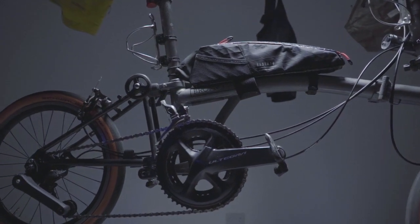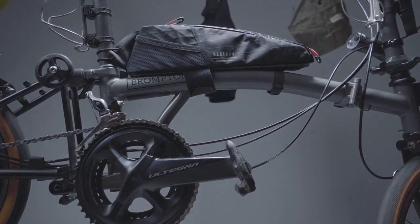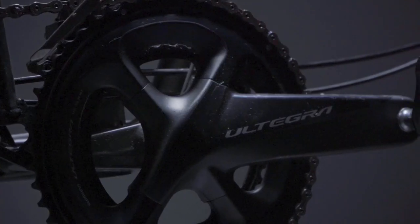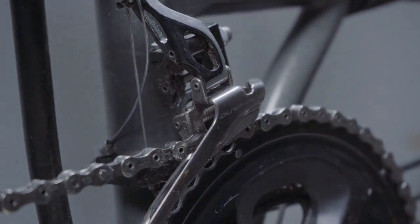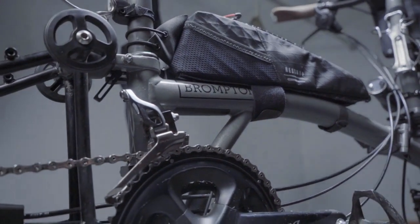There were a few tweaks I made to the bike to make it as suitable as possible for the big distance. I had the standard four-speed Brompton derailleur on the back but added a Shimano Ultegra crankset with a double — a 52 and a 36 chainring on the front — with a Dura-Ace road front derailleur, changing it from a four-speed to an eight-speed, using a Sunrace friction shifter for the front derailleur. Just a bit more versatility, mainly for the hills around Kendal in the Lake District and up near Moffat where it gets lumpy.